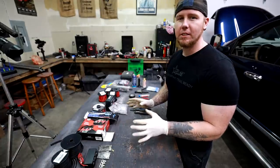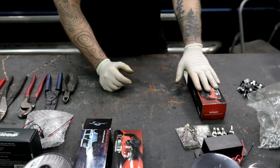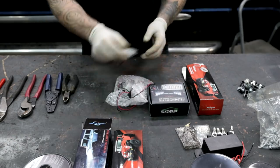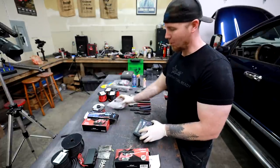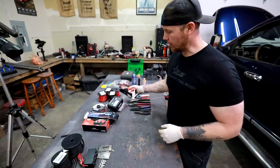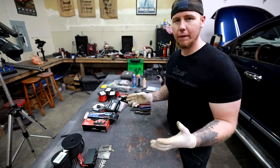I have three separate relay systems that I'm going to tie into this rear battery. One is going to be for all the lights — we've got a light system here, some lights there — probably two or three of these and then all of these, so we'll have like 10 or 11 lights to hook up. Those will all be hooked up through this relay, which is going to be on a switch that I'm probably going to locate somewhere on the gang box.